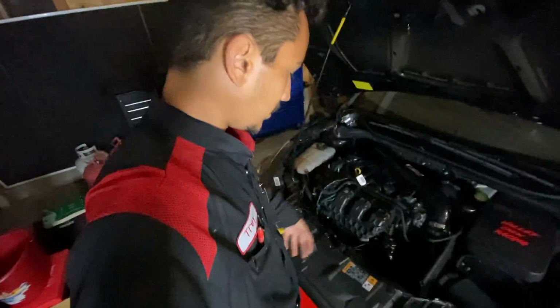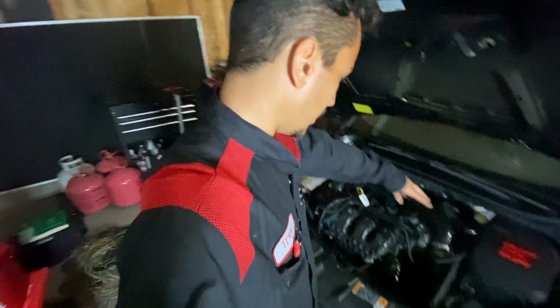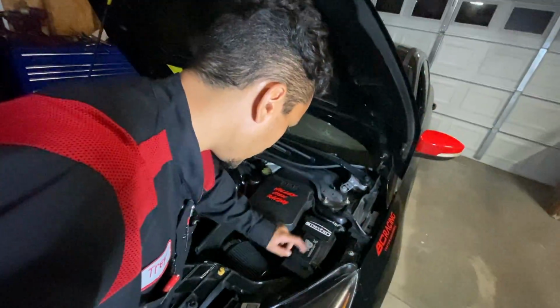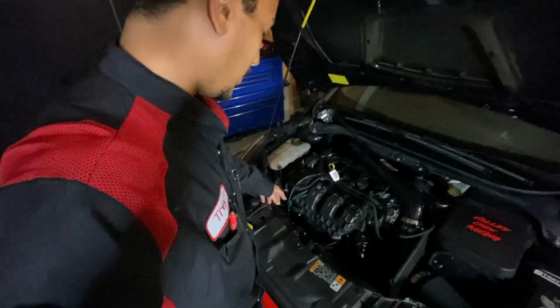All 3 engine mounts, both Damon catch cans for the pressure side of the PCVs and the non-pressure side. I have a Guardian Angel V3 with a 4-bar MAP sensor on there. It's not hooked up right now because we're still tuning on the 3-bar.